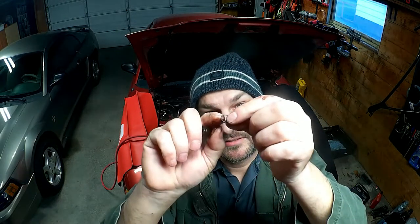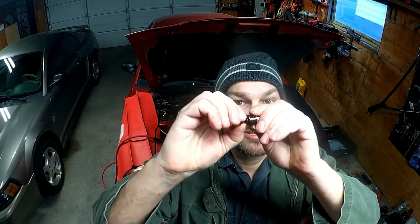Now, if this little spring gets hard varnish, gunk between all its coils, and those are keeping it from tensioning down, then sometimes washing out the oil, using an engine flush of some sort, or using some kind of a solvent cleaner, Marvel, whatever, in there, or even just repeatedly changing the oil on a proper schedule with fresh oil, can clean that out and then cause some of your smoking to go away. However, if the valve guide seals are hard, like this is hard as a rock right now, I'm squeezing on it really tightly and it's really firm rubber. If it's really firm, oil's just going to go past it. It's no longer really serving as any kind of a seal. It's just a channel that oil drops through.